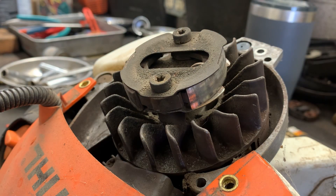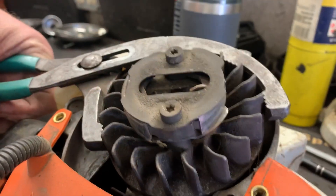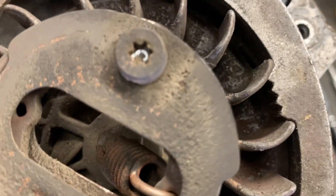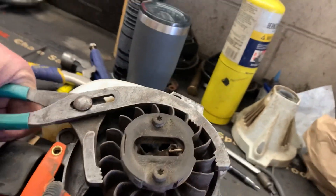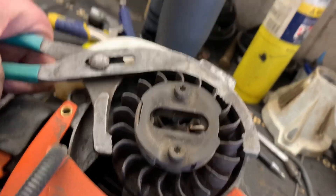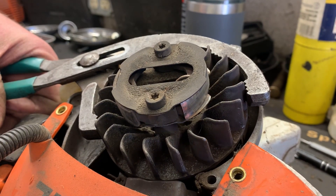Let me show you a cool little trick I use with an oil filter wrench. Not only does this style of oil filter wrench work fabulous for taking oil filters off, it's also an awesome flywheel holding tool. Check this out guys — this is like it was made to grip this flywheel. It goes right in between the fins, you can catch it right on the fin, and right in between the fins here, so you've actually got three contact points to hold this flywheel with this oil filter wrench. I'll put a link in the description where you can get this style — they make all different sizes.